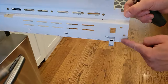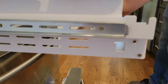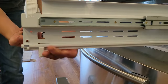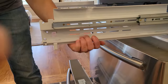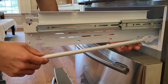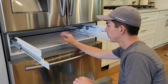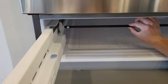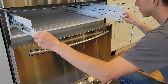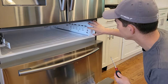Once you're in here, you're going to take the front of this drawer. There are two Phillips screws — one here on the front and one here at the back — that removes this track, as well as these clips where it'll hold the cable. This bar back here just slides to the right and then you can remove it. Then slide both of these back in and loosen the Phillips head screw on the right side and remove this right side track.